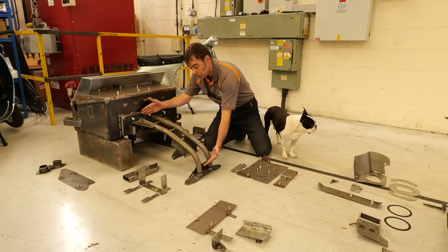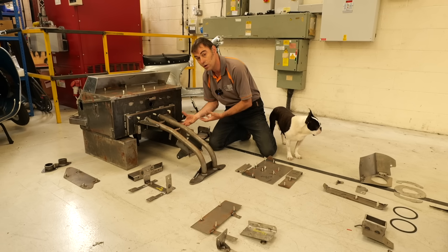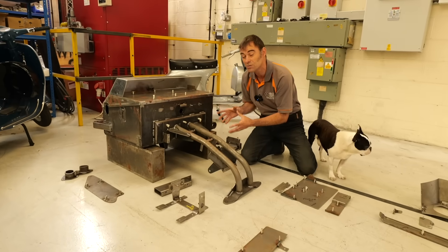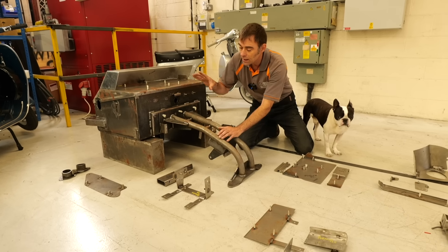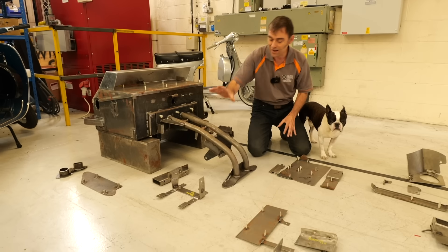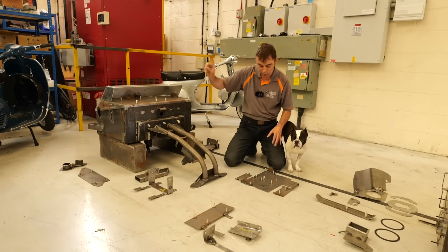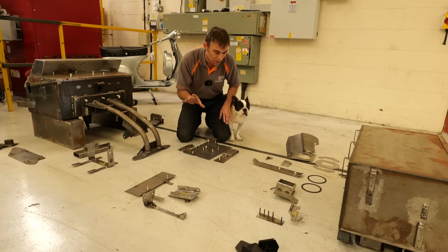It also supports large Tesla drive units and small Tesla drive units, because not everybody wants that huge amount of power with the big LDUs on the back. Over there and over here you've got some bracketry for low voltage items. That's the vacuum pump mount here. Chargers and a header tank go on the top. There's lots of other bracketry here for controllers and other low voltage things.